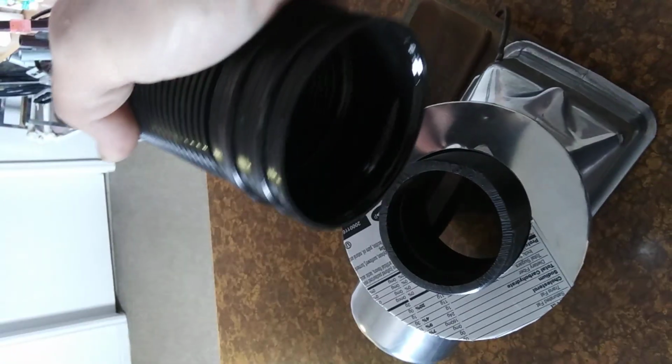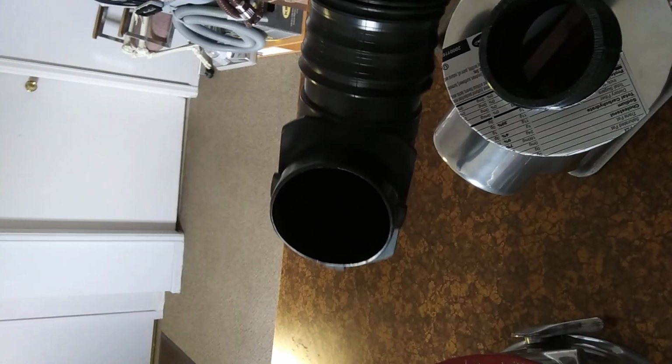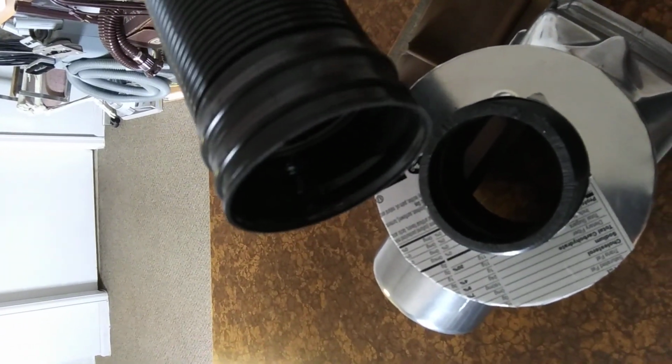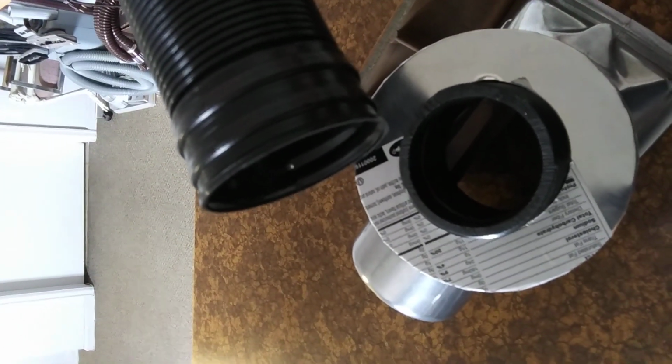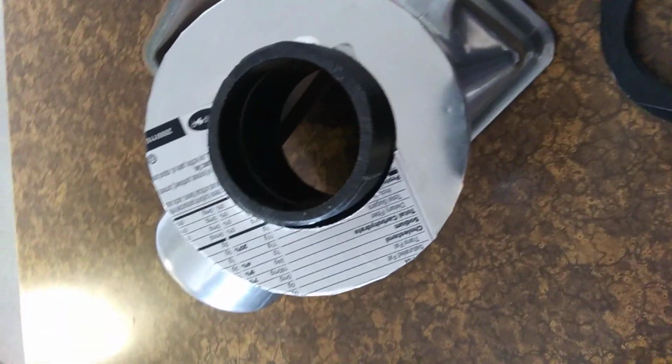And then when it's done, I will heat this up. This is an Avalier 2 fill tube. I got the twist style end. You could go F style if you want, but this Avalier fill tube will fit if you heat this up. Get it really soft, put some grease or Vaseline on it, and then it'll fit over the top of that bulkhead threads. And then of course put a zip tie on it. That's how you convert these.